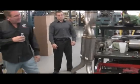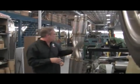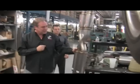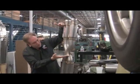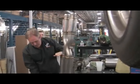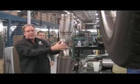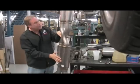Nice piece. And if you look at most middle exhaust systems, there's been a lot of talk on the forums about why our middle exhaust system is so expensive and everybody else's so cheap. Most people advertise what they call an X-pipe, and an X-pipe is usually a piece of straight tubing with an X in it like this, and then sometimes a couple feet of pipe here. This is not the most expensive part of building this. We add 4 resonators in to keep the noise down.